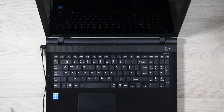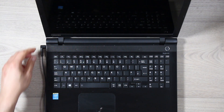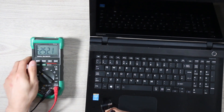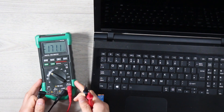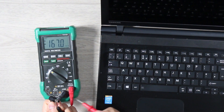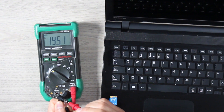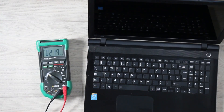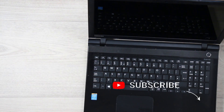First thing I'm going to do is check the charger. I'm going to get my trusty multimeter and test for voltage. I believe this charger is about 19-something volts. On DC — negative out, positive in — we're getting 19.50. So the charger at least seems to be okay. Bearing in mind that with a basic multimeter we cannot test for amps, so don't always assume 100% of the time that DC voltage matching the charger's rating means it's absolutely working fine.